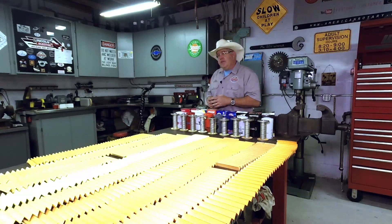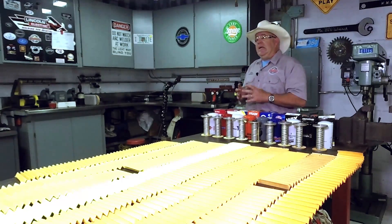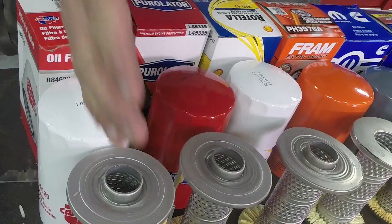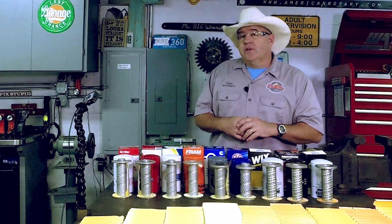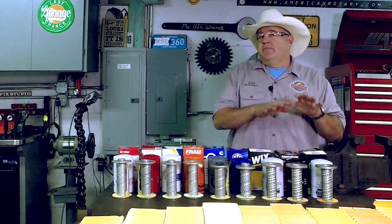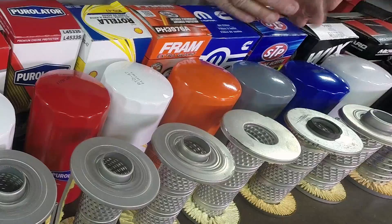The Shell Rotella, the Purolator, and the CarQuest were all three identical filters rebranded under different brand names. These also have the least amount of filter media of all the filters we took apart. The other problem these filters had is the pleating was very inconsistent throughout. Overall though, they're pretty well-made filters — the bases are robust, they had good gaskets, and the cans were made of very strong, high-strength material. Moving to the other end of the table: the Wix, Napa Gold, and the MicroGuard filter — O'Reilly's house brand — are all three identical. Same amount of filter media, same construction, same stamp marks. These three filters had the most filter media, second only to the Mopar Cummins factory filter, which by far had the most filter media inside of it.